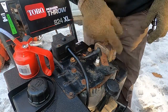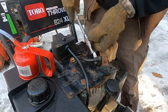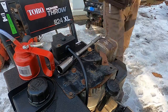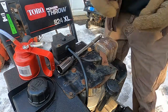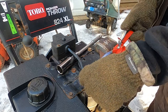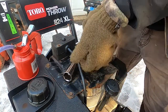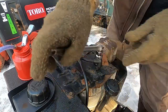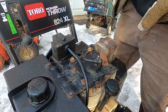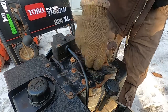I really want to give this the best shot to succeed and trust our results, so I'm pulling the plug out. I didn't check for spark, but Eric said it caught the other day, so I'll take his word. The plug looks rough — I'll go inside and clean that up. We cleaned and gapped the plug. Now I'm going to stick a little two-stroke fuel down the throat and see if it barks. If the fuel and carburetor are good it should light off — this is just to confirm it's genuinely a non-running machine.